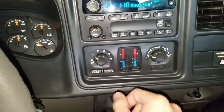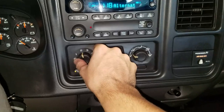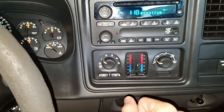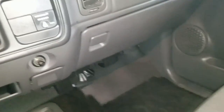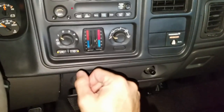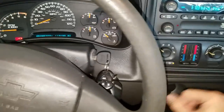What's going on guys? This weekend I'm working on a Silverado. What I'm gonna do is — it doesn't have speed one, I got two, three, four, five but not one. So it's gonna be the blower motor resistor, which is located underneath the glove box. Luckily I have an extra one from another truck I worked on, and it's a little different but we're gonna see if it's gonna work.